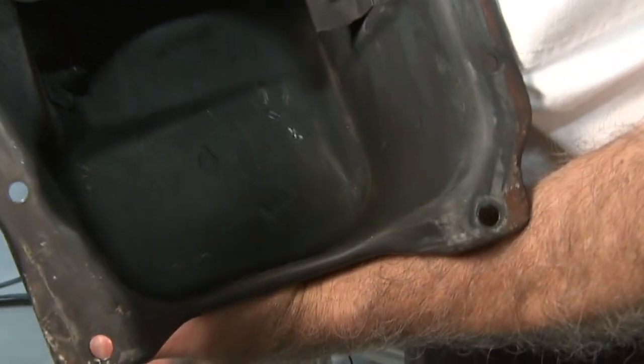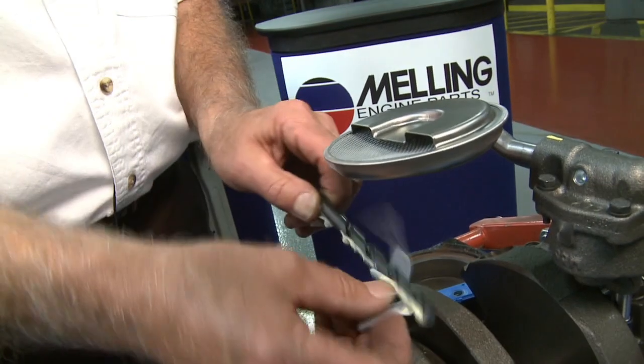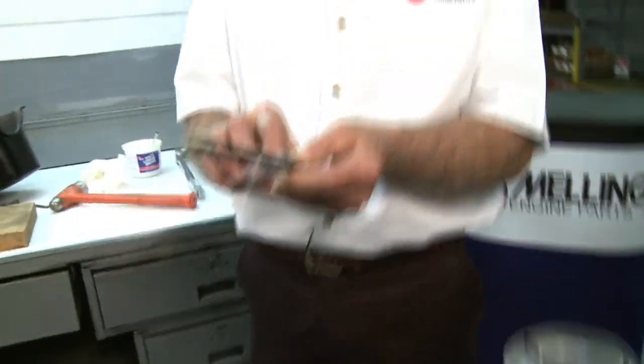Then we're going to remove the pan and check for a witness of grease on the pan. If there's no grease, the clearance is okay. If the pan rides on the drill and clearance is present under the pan rail, the screen is too close. Don't forget to remove the drill.